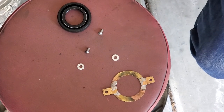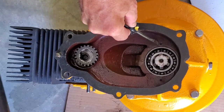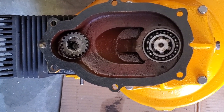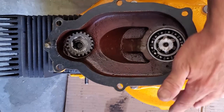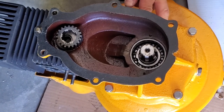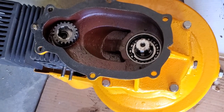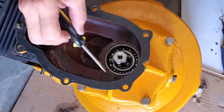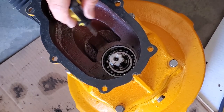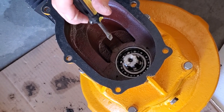And let's go back over and look at the case for a moment. On each side down here, I have drilled into the case. And one thing to notice, right here on the side, there is a gusset here and there is a gusset here. I have put those holes where the gusset is so that I wasn't going to miss the metal. So those holes are where the gusset is. And those are the two holes I then tapped 10-32. They were drilled extra long, tapped 10-32, and I have short screws so that I didn't break off the tap in there, and I could definitely screw the device down.